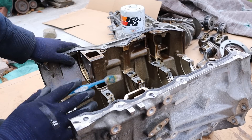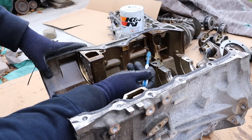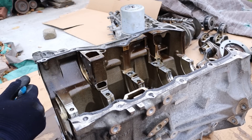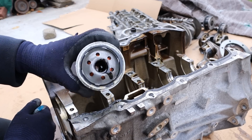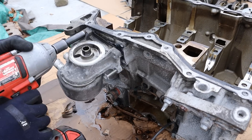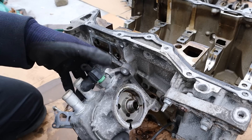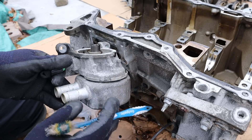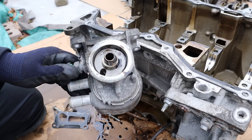Starting at the bottom of the engine block, this is where oil is drawn in through the oil pump and sent down this oil galley to the oil filter to get filtered out. It's a standard canister-style oil filter, which I like. The oil filter housing is straightforward — oil in, oil out. Over here we've got the oil pressure switch. On the back side we've got an integrated oil cooler where coolant comes in and out to help cool down the engine oil at higher loads.